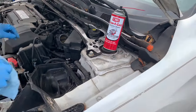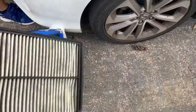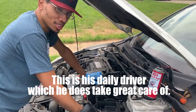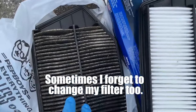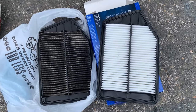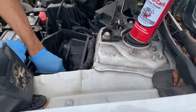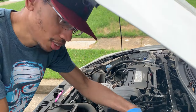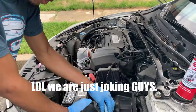After we get this cleaned up, we're also going to replace the air filter. After two years this is what an air filter looks like - change them every two to two and a half years. Here's your new air filter versus the old one - you can see the difference. Don't forget to clean out the intake as well before putting in the new filter.